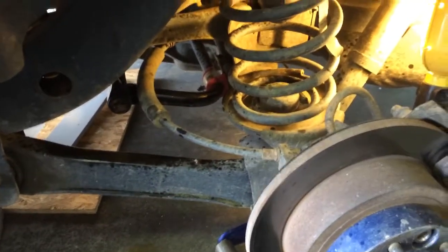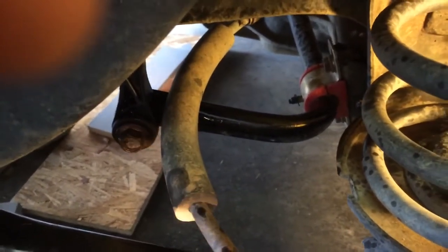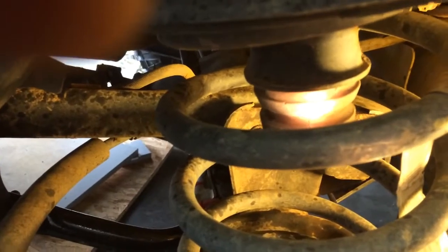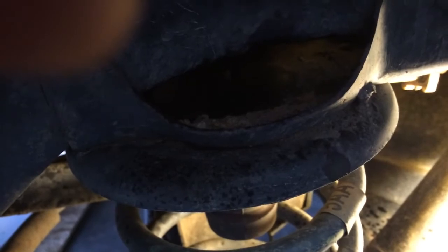We've got the Jeep jacked up, we have a jack stand under it, and the tire for backup. Sprayed a little PB Blaster in here. I do apologize for the lighting — it's a little dark in my garage, but it's really cold and rainy outside. First thing we're going to do is take off the sway bar bolt to disconnect the sway bar, and we're going to take off the bottom shock bolts. Once we've done that, we'll be able to lower the axle, pull this rubber grommet guy out of the bump stop, and there's a bolt inside the bump stop we'll remove as well. Up top is how you can get some access to spray some PB Blaster or whatever you like on top.